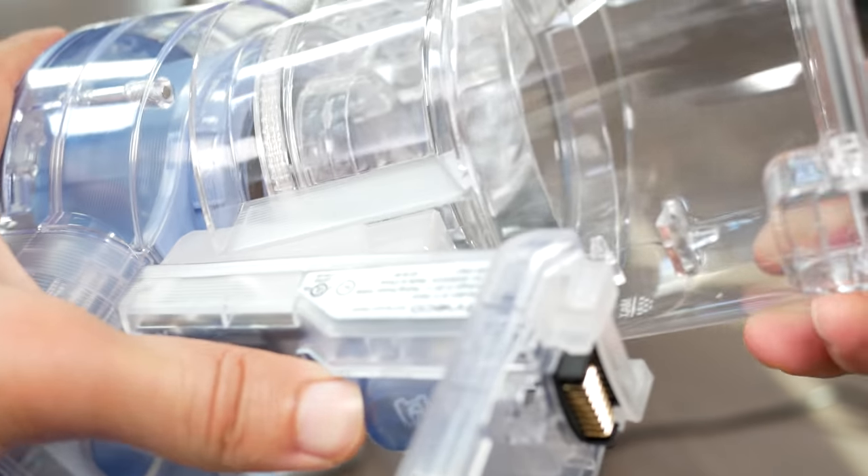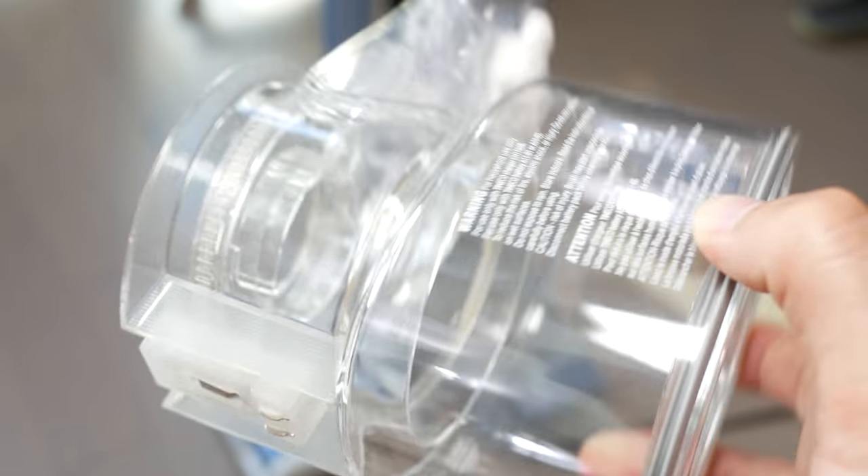The A11's dustbin is 0.2 liters bigger than the A10's. The A10 has a 0.4-liter dustbin, while this A11 series has a 0.6-liter dustbin — it's quite large and can hold a lot of dirt. That said, I just dump it out between every session rather than let it fill up, since a full bin can reduce suction power. You can also fully detach the dustbin and run it under cold water to clean it thoroughly, though I personally just eject the dirt each time — detaching and washing is too much work for me.